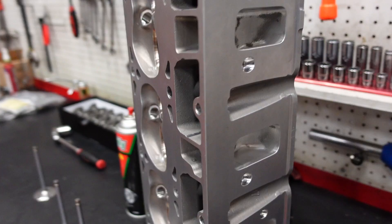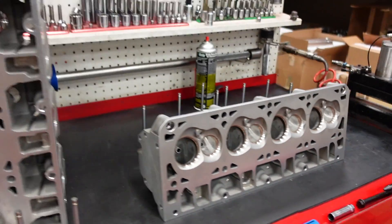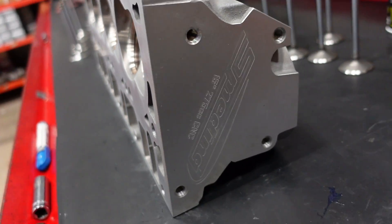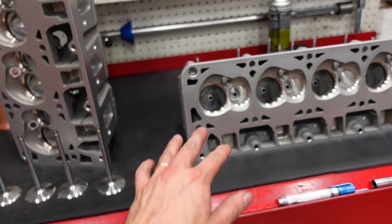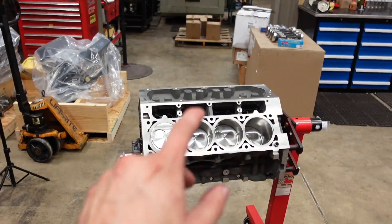Smedding 15-degree, 275cc ported LS3 monster heads. I'm not going with LS7 heads on this build because Vin's biggest concern was he wanted it to be absolutely and utterly reliable. On an extremely aggressive LS7 12-degree setup, especially in a road race car that's going to see a lot of RPM for a long time, I don't like how fast the valve guides wear out. But 15-degree setups are proven to be more reliable. So we're going to do our Smedding 15-degree 275 head. This bad boy flows about 380 cfm at 600 lift and it's going to have an amazing torque curve for this 441.